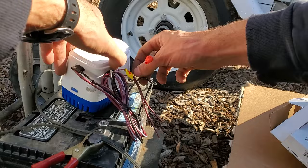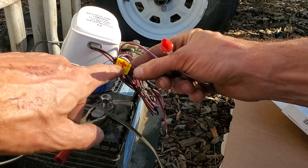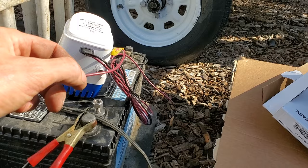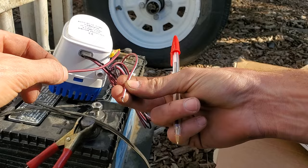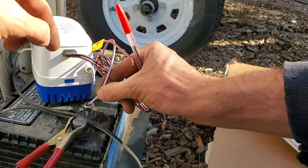I'm not sure which wire is which here, let's find out. The one with a little tag with a red plus sign — this is going to go to a switch on the dash of your boat with a bilge label. You flip the switch up and it'll have 12 volts coming in and 12 volts going out. The white and burgundy wire — this is the automatic 12-volt. You would connect that to a 12-volt source as well, but this is only going to work when water comes up and triggers the float inside.